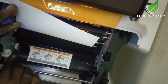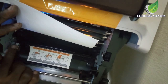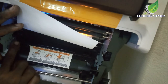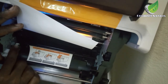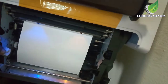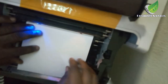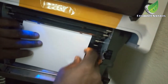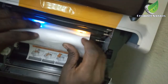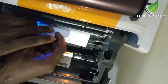I will check if this gear is the issue — that is one of the areas I'm going to check if your HiTi photo printer doesn't initialize. I'm going to apply grease to this particular area. It is very important that you apply grease here because it controls the movement of the paper and the ribbon. Apply grease to it just like I've done. You have to apply the liquid kind. If you don't know the kind of grease to apply, hit me up in the comment section and I will give you a link or the name and specification of the grease to use for this part of the machine. Now I'm going to remove the paper and refeed it inside.